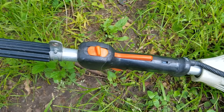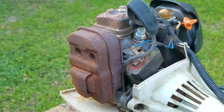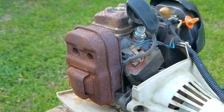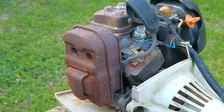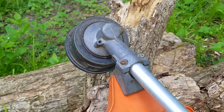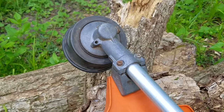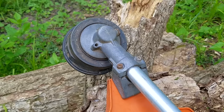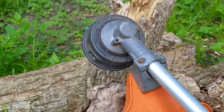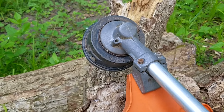It turns out the clutch and the rest of the engine — as a matter of fact — is very rusted under the cover, so the clutch, once engaged, stays that way. I can confirm the clutch is stuck because if I slowly pull on the rope, the trimmer head spins as well, which it's not supposed to do. So I had to take out the clutch and remove as much rust as I could. Even though I had to do it multiple times, it does work much better, but I would suggest replacing the clutch in the future.